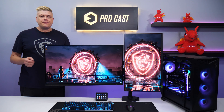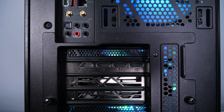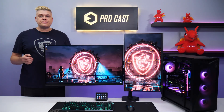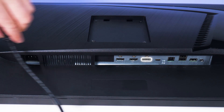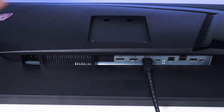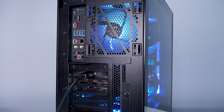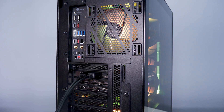Connecting up a new monitor is easy. For video, we have HDMI or DisplayPort. Use DisplayPort for your main gaming monitor, and as most GPUs have three DisplayPorts and only one HDMI, you'll likely need DisplayPort for any additional monitors. Just plan to grab long cables to reach, plus cable manage your DisplayPort wires. We'll plug in the DisplayPort and power wires to the back of the monitor, and upstream USB if you want. On the back of the PC, the DisplayPort goes into the GPU, and connect the USB upstream.